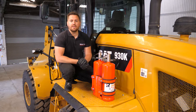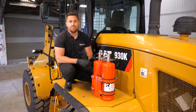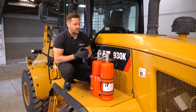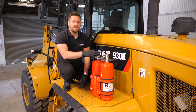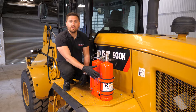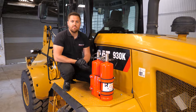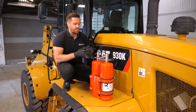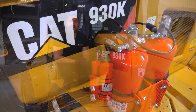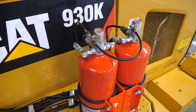What we have here is the heart and core of the React-On technology. This is the P-Mark 25-bar system, which is made up of a patented indirect valve from React-On. We have on this side a fluorine-free wet chemical and a dry powder on this side. Both of these work in harmony to provide an SPCR199 A-plus accredited system.